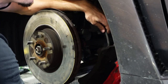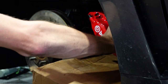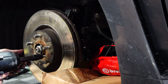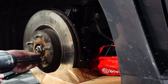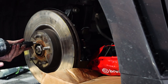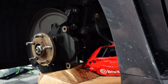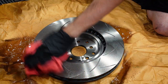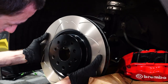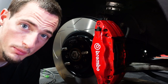You don't necessarily want to let the caliper hang by the brake line, so I'm going to just sit this up here for right now. I have this threaded bolt — I'm going to use that to push the seized rotor off. Looks like that did the trick because the hammer was not doing it. Now we've got the new rotors — just going to spray them down with some brake clean and wipe them down real good. Then line up the holes and slide that on there.